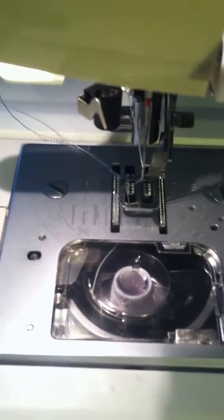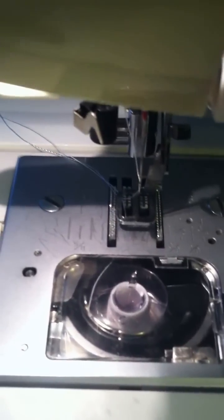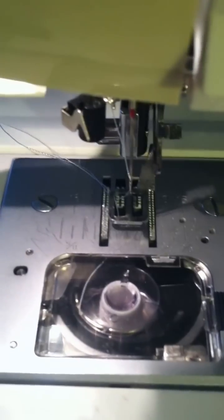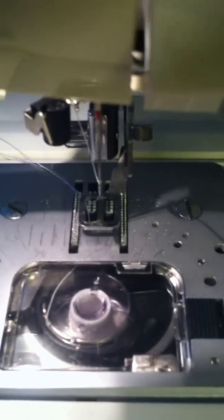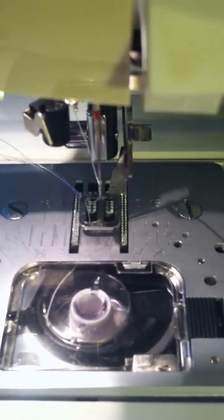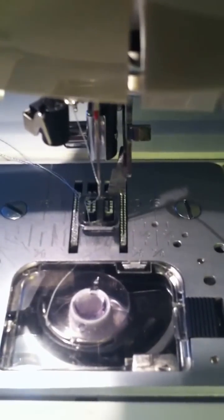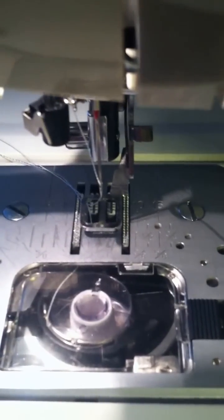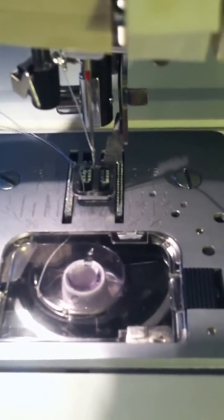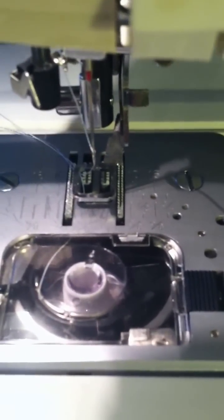Basically, you're having issues with either the needles breaking or the bobbin casing and bobbin jumping out of place, nesting under your fabric, under your stitching, or loops on top of your stitching. Some of that could be tension related. I have found 99.9% of my issues come from that bobbin case.